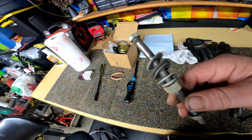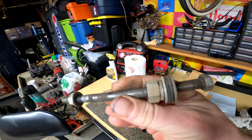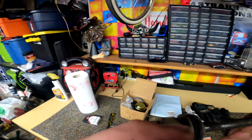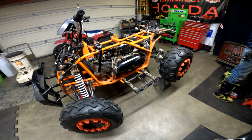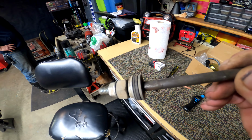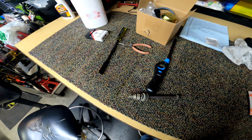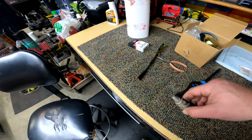All right, well, there's some funkiness going on here. That's all I can say, because this is a motor mount bolt. For some reason, there's an extra large nut on there, which normally when you do something like that, it's because it's stripped out. But in this occasion, what I think was happening is this bolt is just way too long for that motor mount. So somebody was trying to make up a gap difference by using a bolt, which is a trick I've commonly used once in a while when you don't have enough washers. Problem is they weren't securing the motor because they were on the outsides of the bracket instead of the inside. So we gotta change that all around.